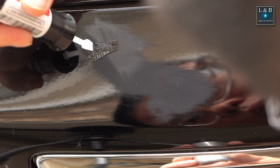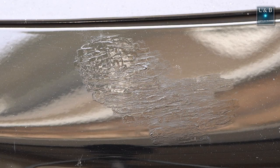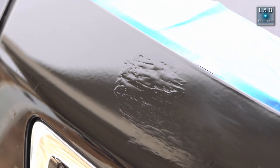Once you're happy with the smooth surface, go ahead and add the clear coat. From the bottom of the touch-up paint container I took out the foam brush, which in my opinion isn't the best — when spreading the clear coat it creates a lot of jagged edges and isn't very smooth. I added two layers and then sanded with the 1000-grit sandpaper, spending a lot of time at this stage. Any little imperfection will really show up after polishing, so make sure the clear coat is very smooth and blends with the rest of the surface as much as possible.